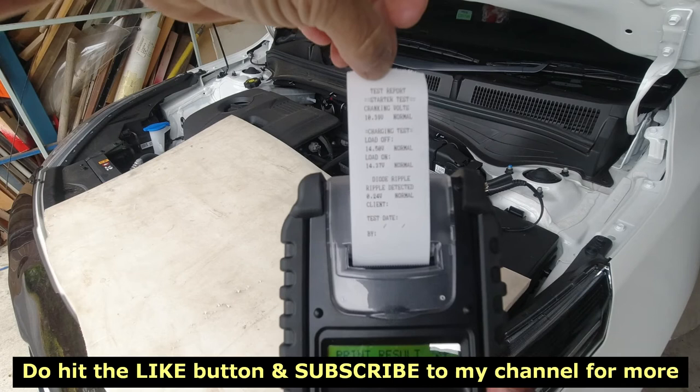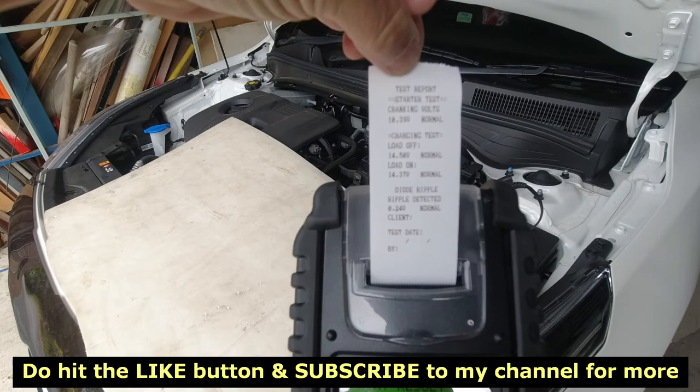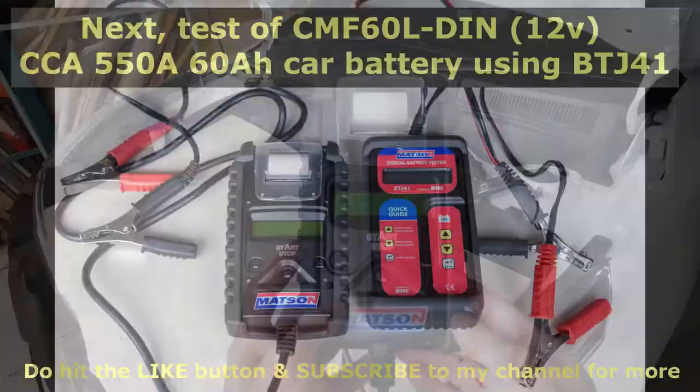It tells me the cranking volts is normal. It tells me the charging tests are normal. It tells me the diode ripple is normal. That's fantastic. So as you can see, this is very simple test equipment to use, and it is very thorough for lead acid batteries.